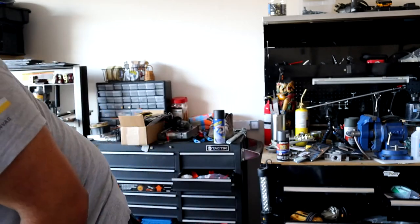It was super simple. It literally took me about 20 minutes per headlight to do all the sanding. And I used more sandpaper than what Chris Fix did. I started from 320, 400, 800, 1000, 1500, 2000, and 3000 grit. Do you have to? No. The only reason I did is because I had the sandpaper and it was just like, might as well, right? I did 4 coats of clear. And after it was done with the clearing process, I went back and re-sanded the front with 3000 grit and then added the Turtle Wax carnauba wax, 2 coats of that. Super soft on the front of the glass. You can totally tell that I took the oxidation off, so awesome.